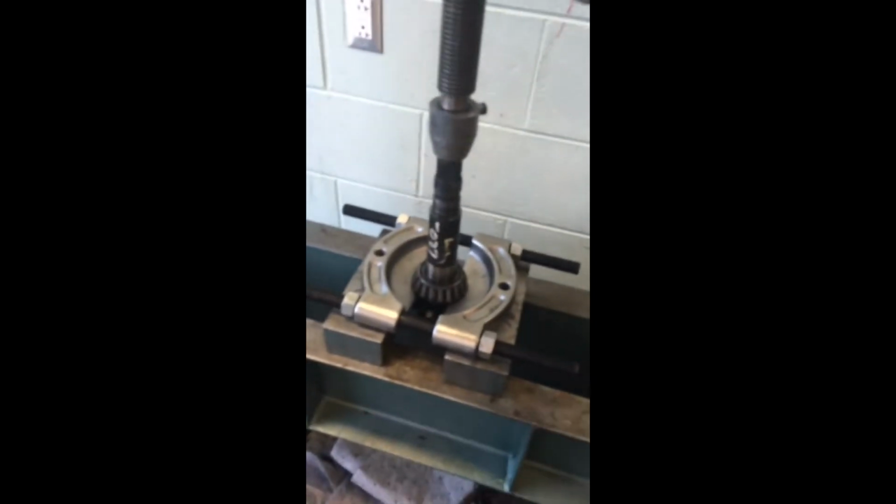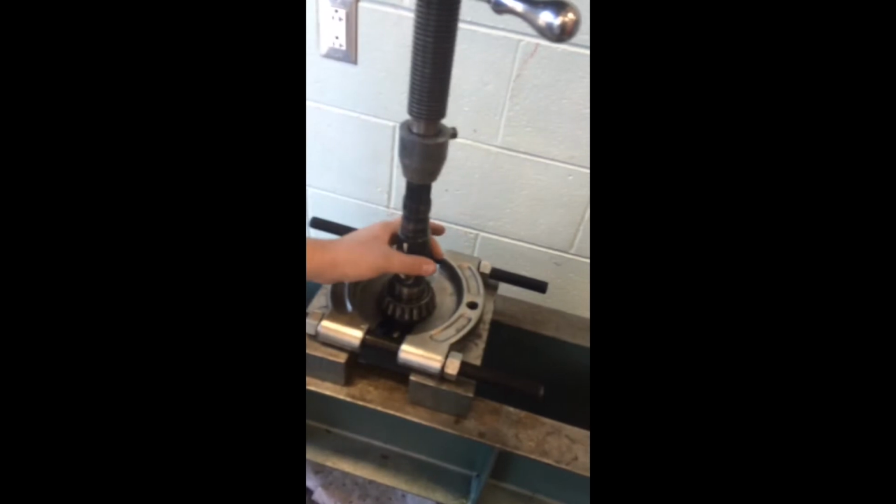The next step is pinion depth measurement. This involves removing the bearing from the pinion shaft and the transfer shaft to correct the pinion shim. This will allow us to measure the height of the pinion shim and also set it to the correct height on the ring gear, as the pinion will be riding directly on the ring gear. The pinion bearing will need to be removed first, as it's used in the measurement procedure, as you'll see now.